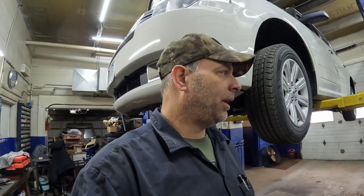You can kind of bank on any kind of coolant leak up front like that being the water pump. There's really nothing much else there that we have issues with on these. The 3.5 in general has been a pretty good engine — the naturally aspirated 3.5. This is going to be a short video. I'm going to start pulling the top end apart. We've got to get our cam holders in there, our tools, and then get this timing chain pulled off, get the water pump out of it and switch it over.